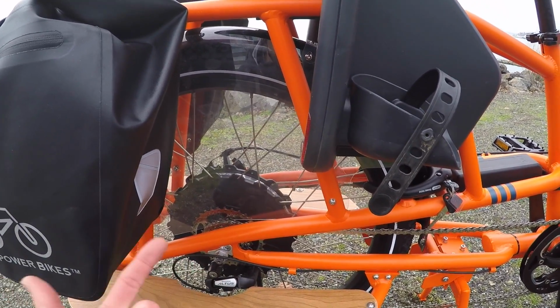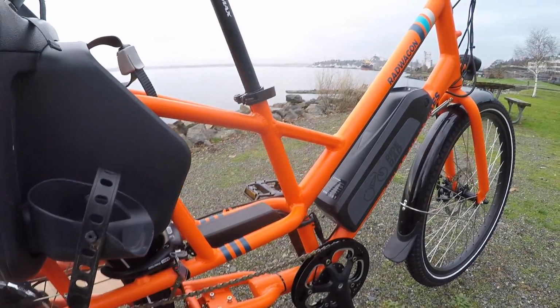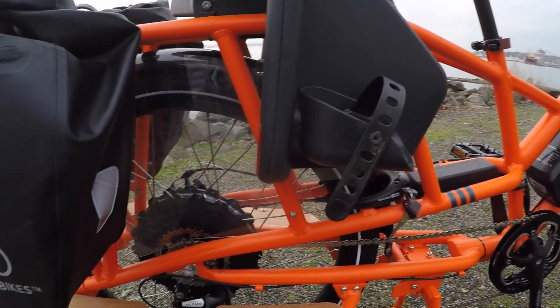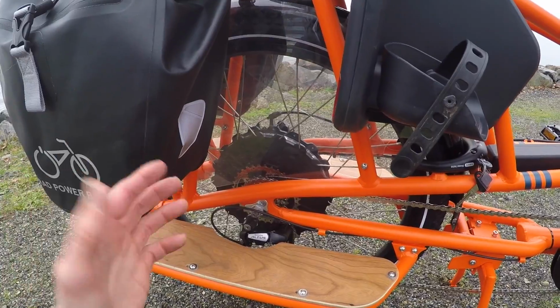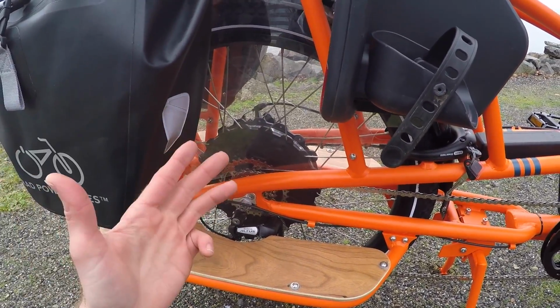It's automatic. On the display, you can even see how many watts you're regenerating. It goes right back into the battery. It's not a perfect solution. It's not like 100% efficient, but it's better than nothing, and it helps reduce wear on those brake pads. So it's a cool thing to do with an otherwise very durable, smooth, quiet motor.